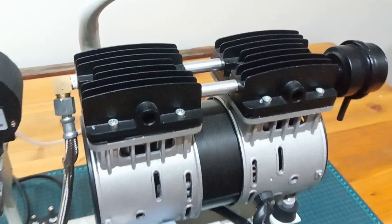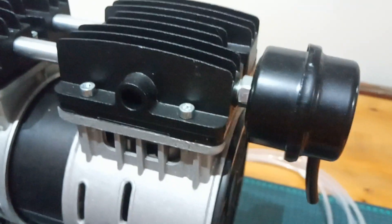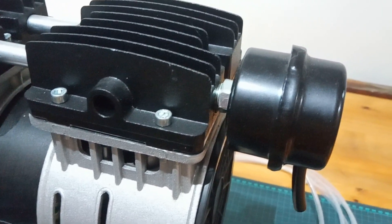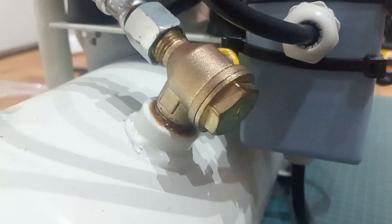This is a conversion I've done a few times. It's quite simple — you'll just buy the pump and then take the connection off the inlet here into the tank and the filter off the other end. Then you want to look at unbolting the whole pump off its four screws or off its two brackets. Then it's just a matter of lifting the pump up, turning it around 180 degrees and connecting those connections back up. So we're now going to have the tank connected to the vacuum side of the pump and the filter connected to the outlet side of the pump.